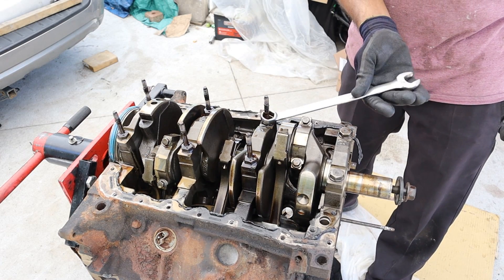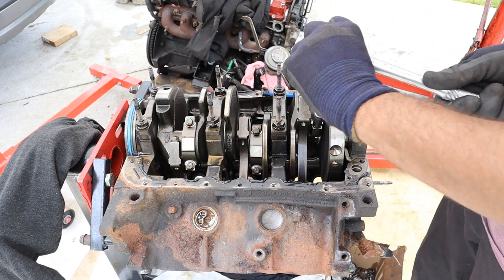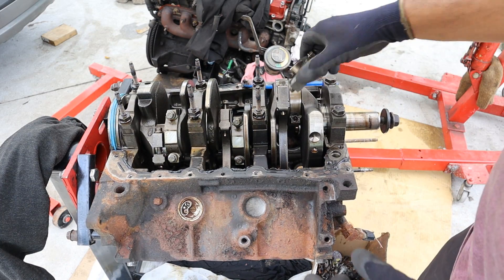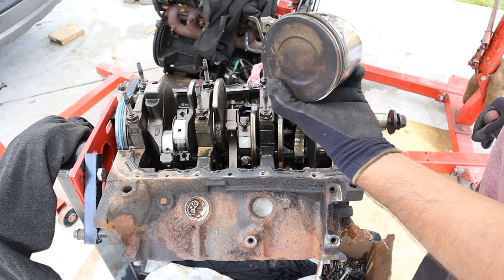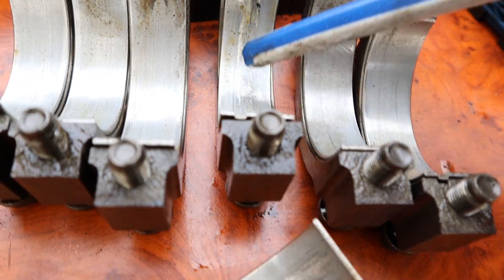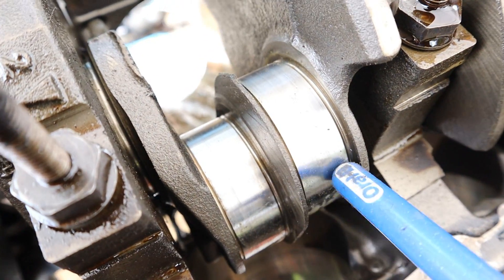What I don't like is that they're using studs instead of bolts on these main caps, so I actually have to use a wrench. Now that I've cracked the main nuts loose, I'm going to go ahead and crack the bolts for the connecting rods — these are an 11 millimeter. I'll zip these free, pull off these connecting rod caps, and now I'm going to push these pistons down. Whoa, these are giant pistons — I guess because it's 3.8 liters over only 6 cylinders and not 8. That last piston came out with a whole bunch of slurry on it. Most of the rod bearings look okay, but when you come to cylinder number 4 you can definitely tell there's been a lot of scoring. Its associated bearing also has a lot of scoring on it, so this one probably took the hit when it came to mixing coolant with the oil. Luckily it didn't chew the crankshaft and that's in pretty good shape.